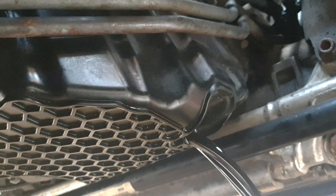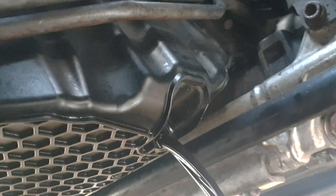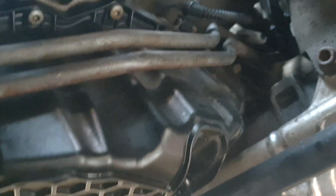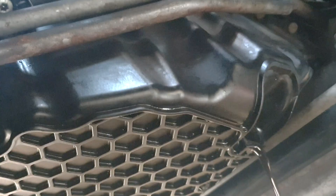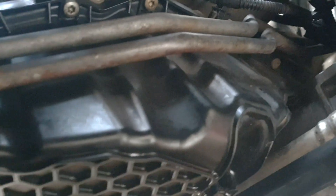While the oil comes out, you could go prepare to take off the oil filter and just let it drain out. There should be like 5 litres to come out of this — just try to monitor the oil and see if there's anything going on, anything that comes out that shouldn't. That's how you take off the oil sump plug on these 2013 onwards models with the plastic tray — they swapped from metal to plastic, which I don't support.